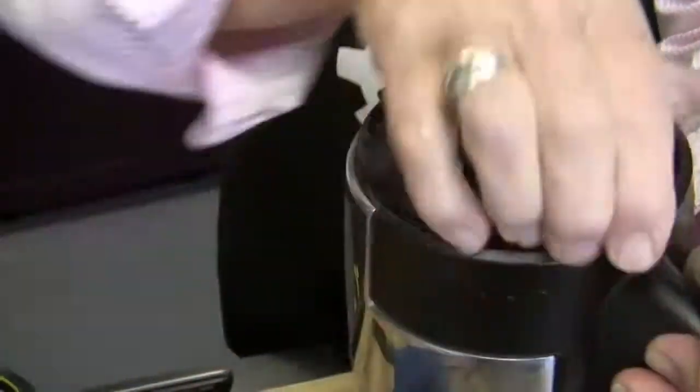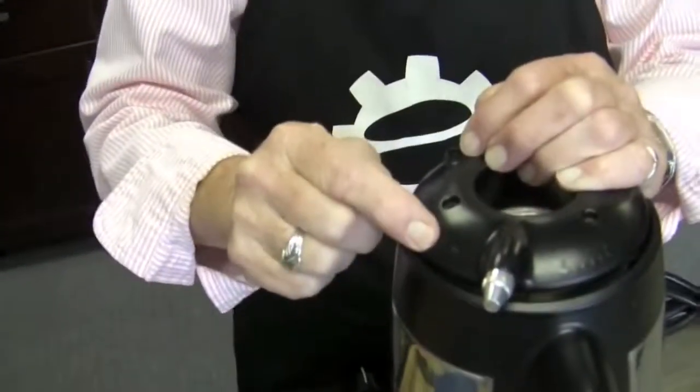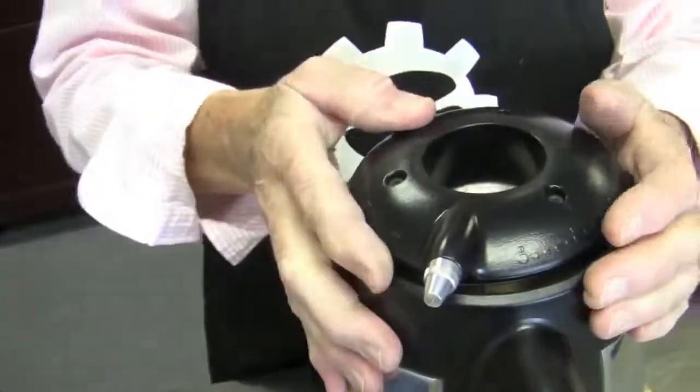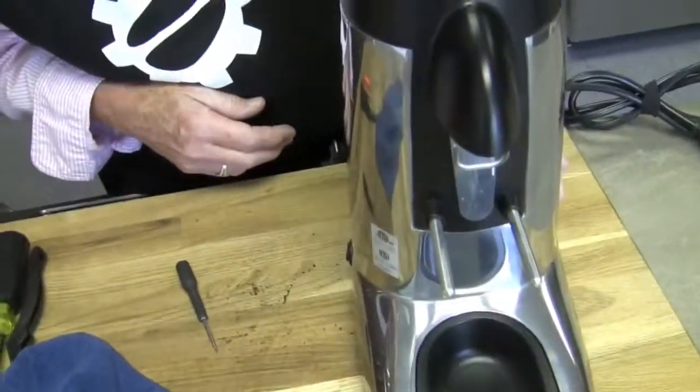Now you're going to stop over here, and then stop on the other side — you're within the espresso range again. If you took it up even just one rotation too much, this screw does not hit the stop, so it just keeps going and going. Easy — only costs you a couple of bucks. So that's cleaning the Compak K3 Touch. Thank you very much, Gail. You're welcome.